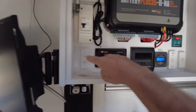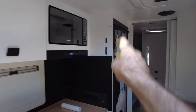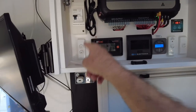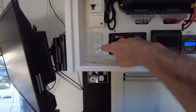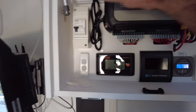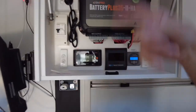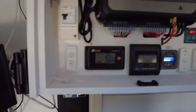And the idea of this, obviously before the inverter, the battery charger and the three-way fridge, was this fridge will pull 375 watts if it ran from the inverter. This Swift hot water service has a 1000 watt element. So if that ran from the inverter, you can see the problem there. This one's a hidden one, as well as the mains charger. Now we all know we can't run a mains charger from an inverter. You can't create power from nowhere. It's not an infinite loop and spiral down into disappearing ampere hours.